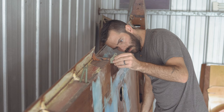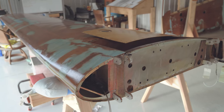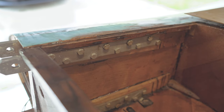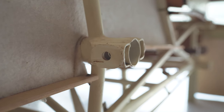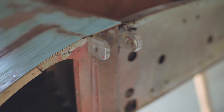Before covering these wings, it was important to make sure they're going to fit on the fuselage. So one of the things we needed to do was trial fit each wing on the fuselage. Once the fabric's on, you don't want to put the wing on and then find out it's not fitting easily. With the help of four other guys, we trial fit each wing one at a time on two different occasions, and it was a huge relief to find that both wings fit on nicely.